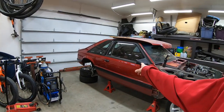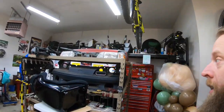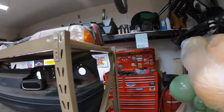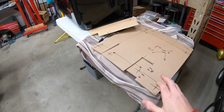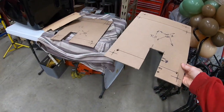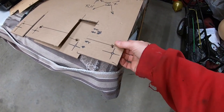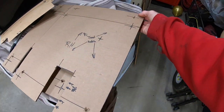Got Jesse back out here working on the Puzzle Fox again. The last thing I showed was working on the rear shock tower reinforcements — I'm working on getting those water jet cut, so hopefully I'll have that stuff soon. In the meantime, the next thing on my list was working on the seat brackets. I had cut some cardboard templates out for the right-hand and left-hand side so they'd mount right down to the floor, with holes where the studs from the floor poke through.